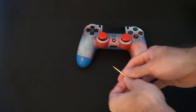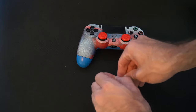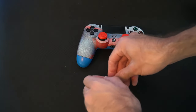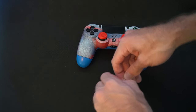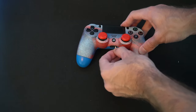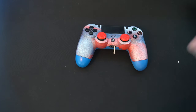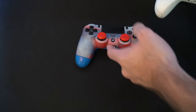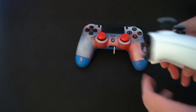So with my toothpick here I'm going to break off the ends to get them a little bit flatter. So I broke that off and bent this off — this is looking good. I'm going to stick one end into my controller's headphone jack and then find something hard to tap it in with, and try to re-seat it a little bit better to the motherboard.